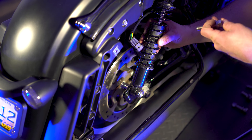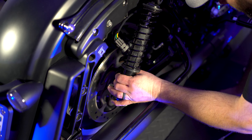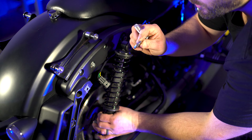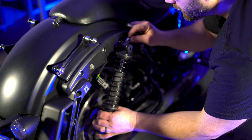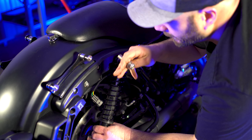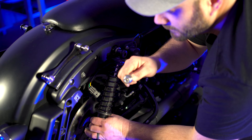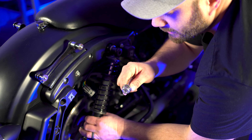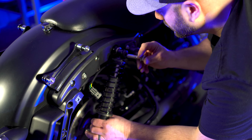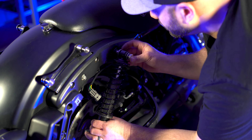Position this, and on the top what we're going to end up with is a quarter inch spacer, so this needs to go between the mount and the shock. Then again, you have a T55 half-13 screw with the lock washer and the regular washer on there. Put that in.